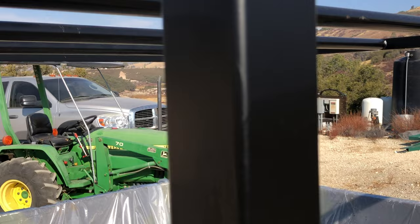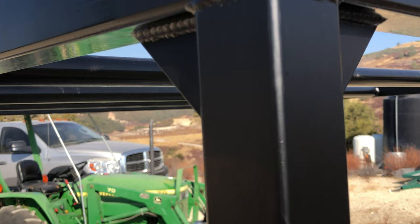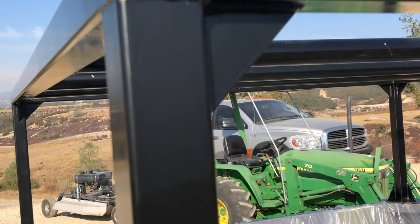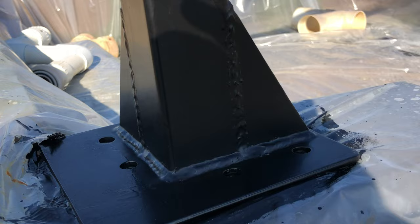And you're looking at the results of the first coat. This is about a week later. It's pretty smooth, it's gone on and it's leveled pretty well. It's a little dull, and that is to be expected because POR-15 is not UV resistant. And so we're gonna put another coat on now. Then we're gonna follow that with a top coat of Rustoleum Black Gloss.